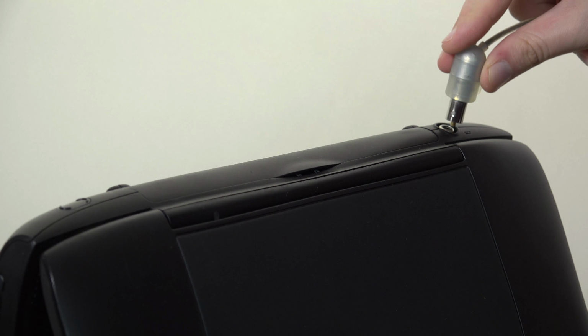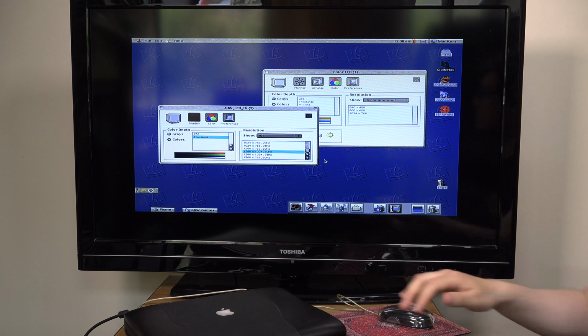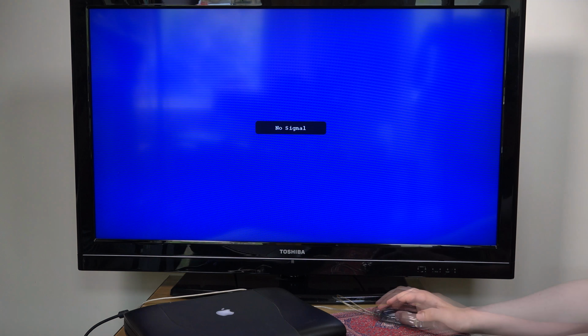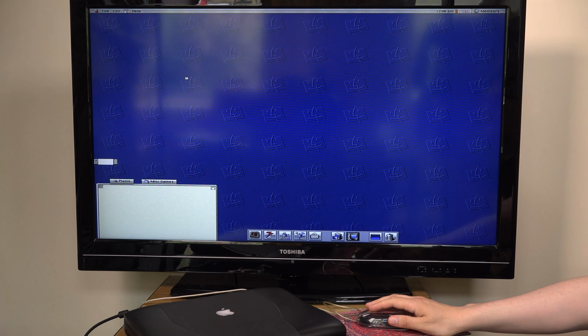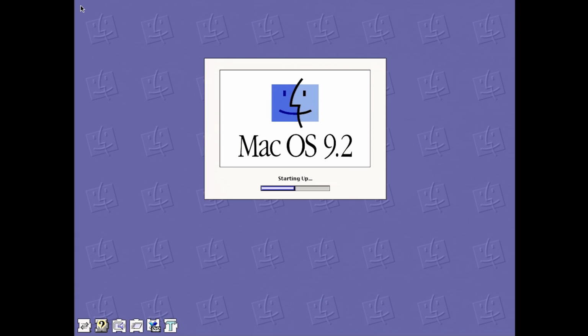Plugging in an external monitor, along with a USB keyboard and mouse, allows you to close the lid once it's booted, and run it in clamshell. For a lot of cases, this will improve graphical performance over mirroring the screen, as doing that splits the 8 MB of VRAM in half, as it drives both. So that's the hardware. What of the software then?